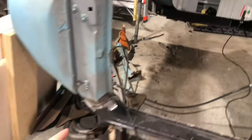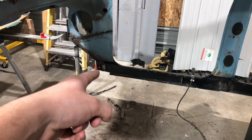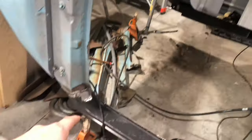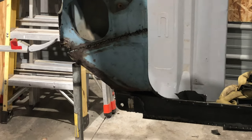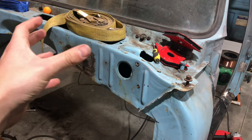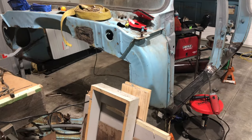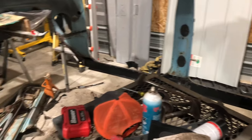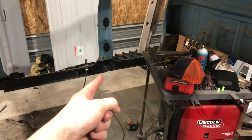Over there are the fender mounts. The outer skin has one, and the stock inner skin has one too, but the inners I bought from LMC didn't have one. So I cut out an extra piece and welded it in there to double it up. I also tack-welded those two pieces together because they were kind of flimsy and I didn't trust the pinch welds. Over there I welded in a plate because there was something for the brake booster that was pinch welded — about an eight-square-inch area with like twelve pinch welds in it. I drilled them all out, ripped it off, cut that piece out since there were so many holes in it, and welded a new plate in. I'm going to come back tomorrow morning and bring that bed out here, cut out some plate, and fill all the remaining holes.